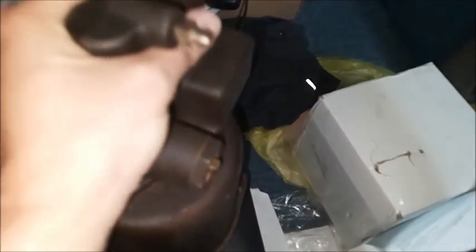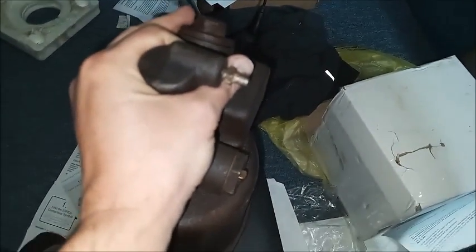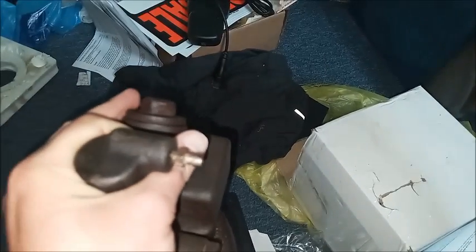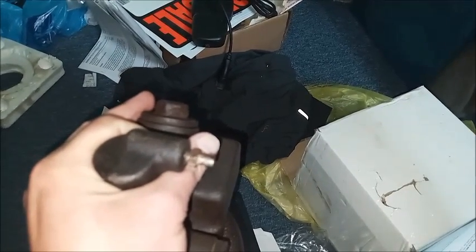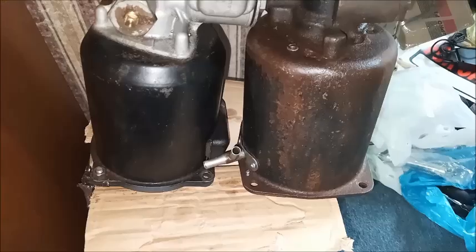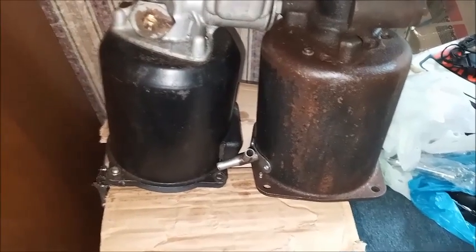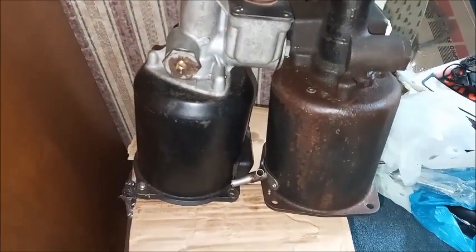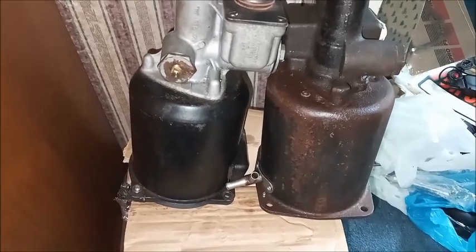The Delco Moraine push rod's a lot wobblier, so it's not nearly as easy to bleed standing up like this. Not that you can't do it. You can do it either here or on the car, bleed the output, and then also the bleeder screw. Bleeding on the car is still really easy because you just reach down and operate the push rod by hand. Piece of cake.